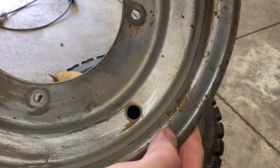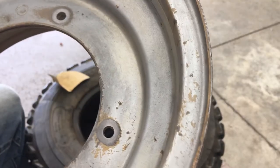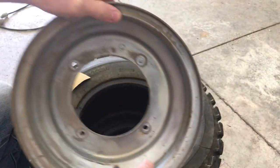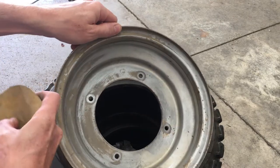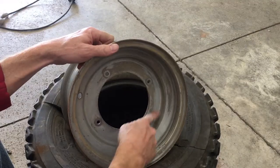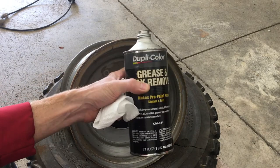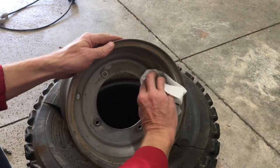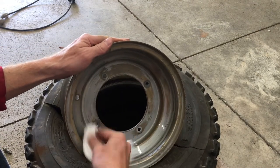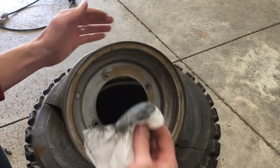I have some scratches from the wire wheel — you can see some of the original gold color under the silver paint. I need to sand down those scratches so they don't show up under the new paint job. This 220 grit paper will do the job. I made a mess sanding, so I'll give this a good cleaning with some wax and grease remover. Always a good idea to be sure everything is clean before painting or laying down the primer — it's all in the prep.